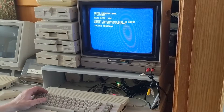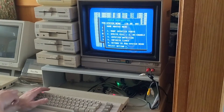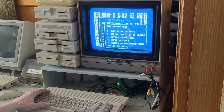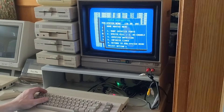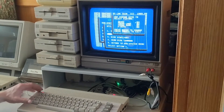There's a monitor utility in it, a terminal program, drive utilities, copier, and you can take a screenshot. The Game Master is actually pretty cool too — swap joystick ports, sprite kills, great if you want to cheat in a game: walk through enemies, auto fire, infinite lives. What it does is it asks how many lives you have now, say 3. It goes through memory and finds variables with that value. Then when you die you tell it you now have 2, and it figures out which variable just decreased from 3 to 2, then keeps that variable from decreasing further to give you infinite lives. The utilities let you enable or disable fast loaders, your wedge, and that kind of stuff.